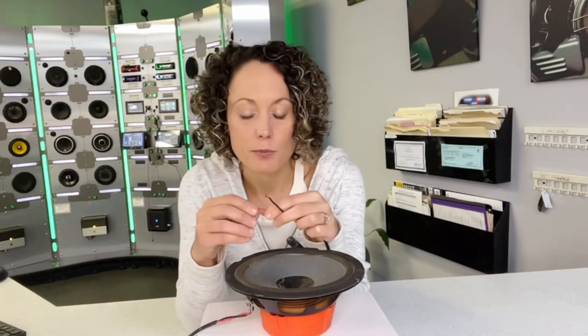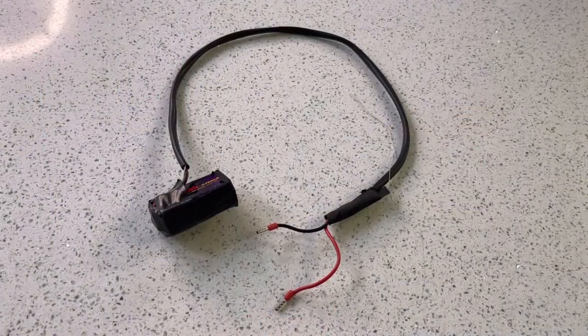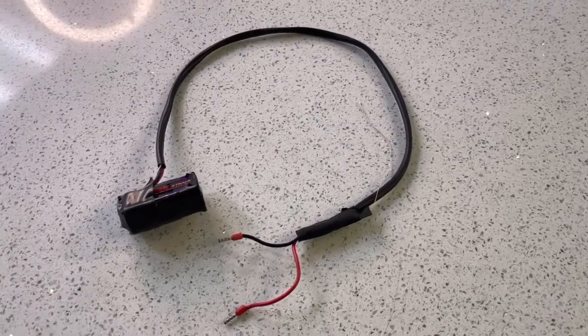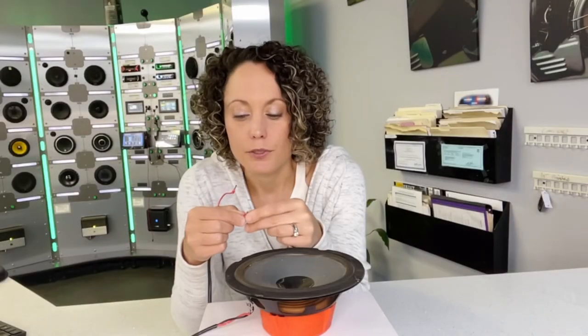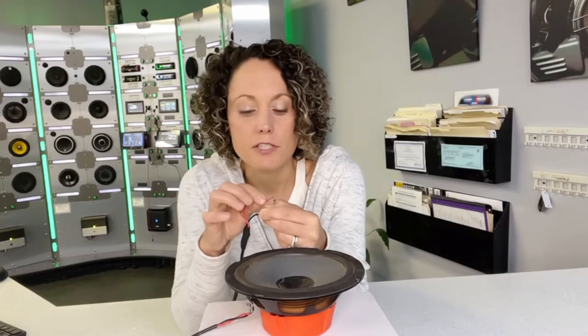Check this out. I'll try to make it easier for you guys to see. So I have some speaker wire — this represents the wiring in the car that we've stripped back, so we've exposed some of the shielding so we can use our little nine volt battery tester that we've put together. And we are going to assume that black is negative and probe the other wire with our positive and see what happens.